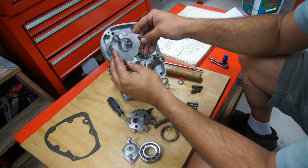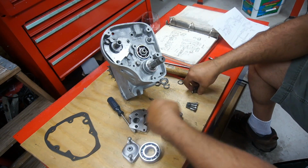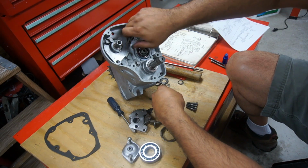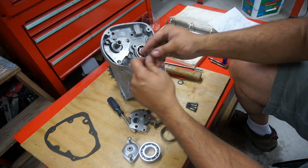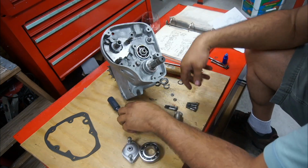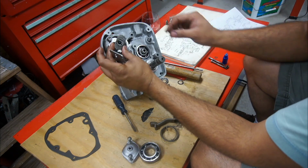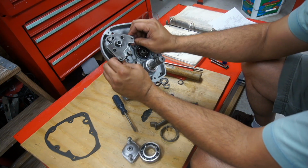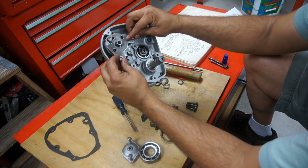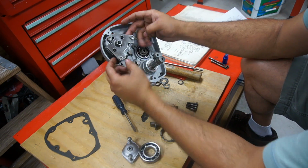Be sure the spring is on here, and the little one up front here. And put the gear selector pins on there with the bush on there. And these screws will go on top here. Have the pins tight before you tighten these on here.